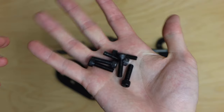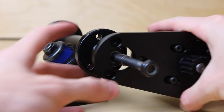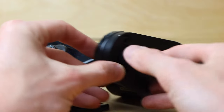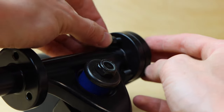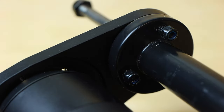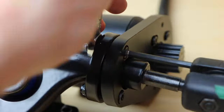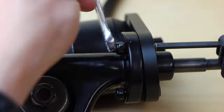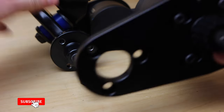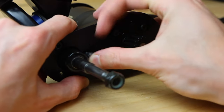For Step 2, you'll need the rear truck, the motor and motor mount assemblies, six M5 bolts, and six M5 nuts. Mount the motor and motor mount to the rear truck by sliding the mount over the hanger, then use three M5 bolts to clamp the plate to the flange on the rear hanger. Thread the M5 nuts onto the bolts and tighten using an Allen key and adjustable wrench. Repeat for both sides so the drivetrain is symmetrical. A cordless drill with a hex bit makes this process much faster.